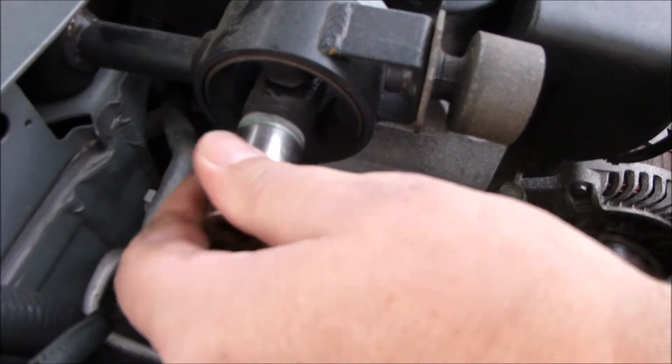Got play in it. So, okay, now the socket problem, wrench problem if you will, is something that mechanics run upon sometimes where one's too tight, but one has play. What do you use? Now I know old Fred's in the background back there saying, put a crescent wrench on it. Well, you don't want to use the crescent wrench because it'll pull apart. The famous issue with crescent wrenches. Put a pipe wrench on it. Well, pipe wrenches aren't really meant for this job either.